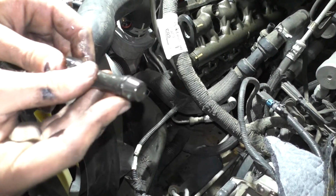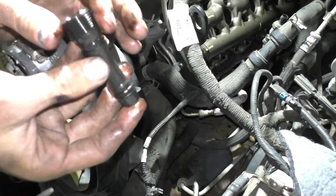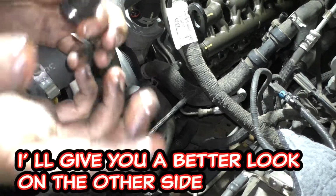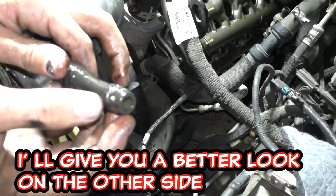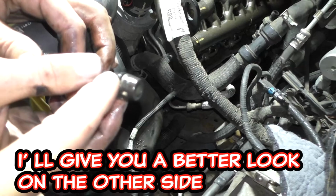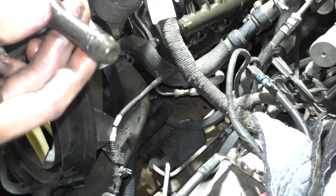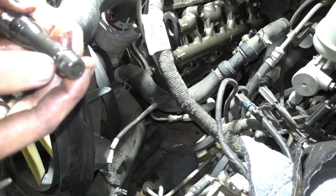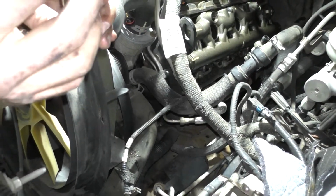And you know what's weird was we were feeling pressure come through the center. I don't know exactly how they work, but either way, you can feel a leak near it. That O-ring is flat on the spots that it's not completely destroyed too, so it's just perished. Even this upper one doesn't look great. It looks much better than that, but I'd say that was the leak. Yeah, there's Bob's your uncle.